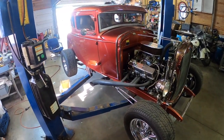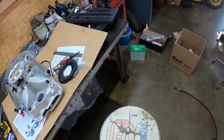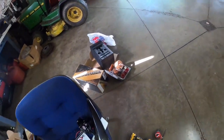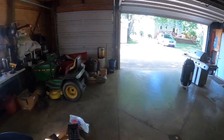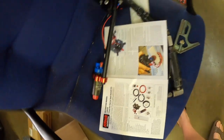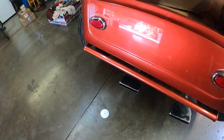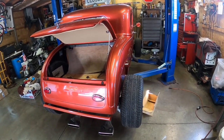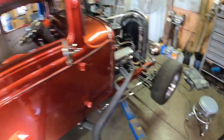We're gonna take the carburetor out and put an EFI unit into it — an Edelbrock actually. We got some of the parts here, got all our stuff from Summit. Really hooked it up, got a lot of good parts at decent prices, but the whole job is going to be fairly expensive just because cars this age didn't really have EFI. The tank, which we're working on right now — my dad's out there dumping it out — we had to drill about a four-inch hole to fit the fuel pump into it. The tank sits right underneath the car. Next step is getting the fuel pump set up, running the fuel lines, and starting to take the manifold apart — taking all the old stuff off and putting the new stuff in.